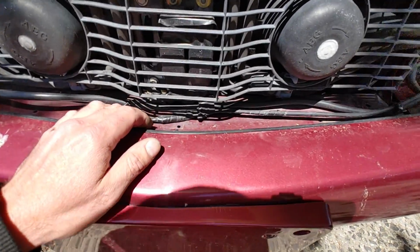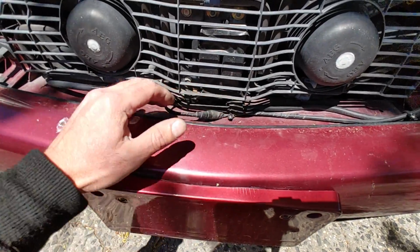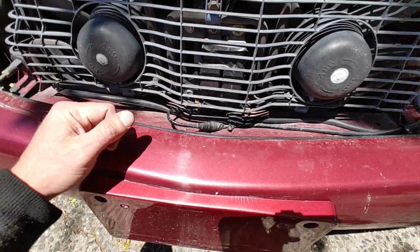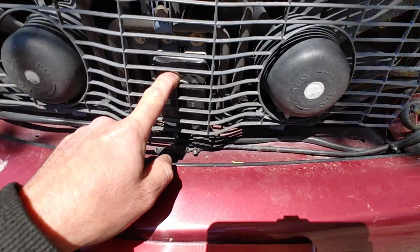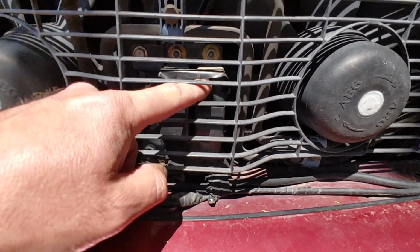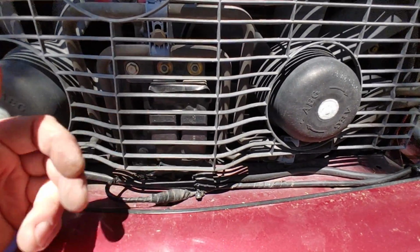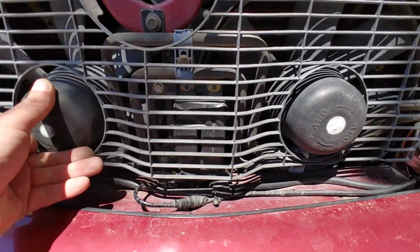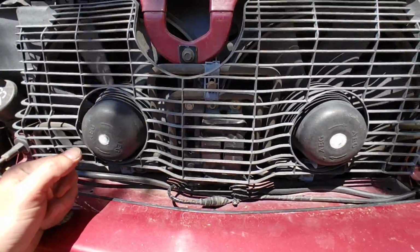There is a theory of mine that it might have been the inline resistor, like a Sharpie marker looking resistor, like a little tube, and they always go bad, so they probably went to the older style resistors that you find here, the regular ceramic ones, small metal ones over ceramic insulators. That's the old school stuff that never fails, versus the one that looks like a Sharpie marker. That one always fails. That is that.